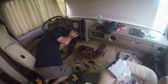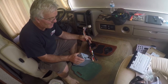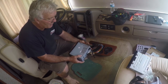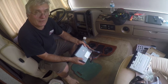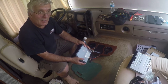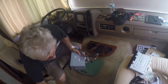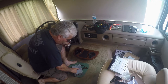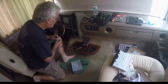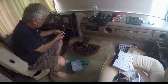Now the mounting is complete — just a quick clean-up and then it's time to start the electrical. The reason I'm replacing this was one: to update it and get Bluetooth. But the other issue was the left front speaker amp wasn't working. I'm sure of that because I switched the front speakers left to right and it was still the left channel failing. There's one other possibility besides the amp, and that's a short in the wiring. So before I hook up this brand new amp, I want to make sure I'm not going to blow the new one. Left front speaker positive, and left speaker minus is the black and white wire. I temporarily removed a lead from the speaker and tested for a short, then hooked it back up and tested for continuity. All was good, so I was safe to continue.